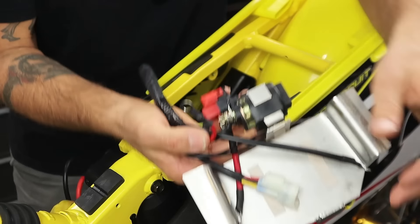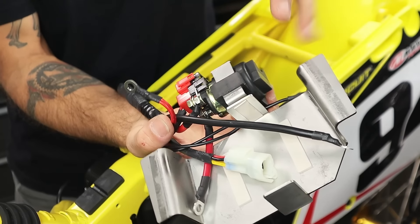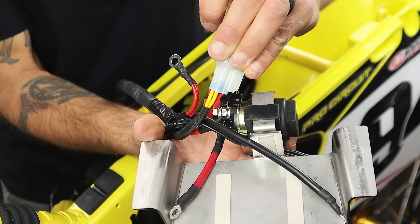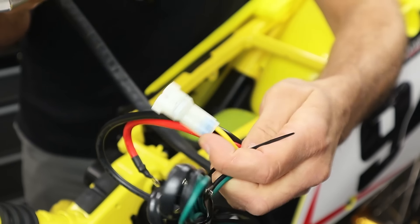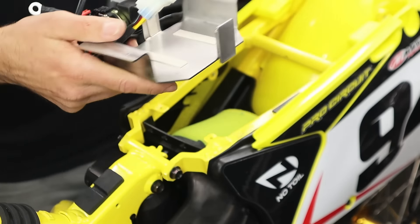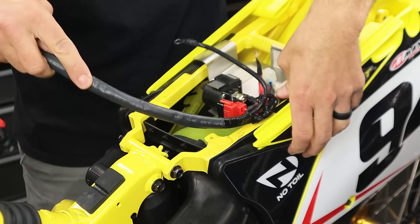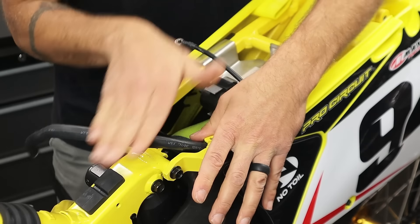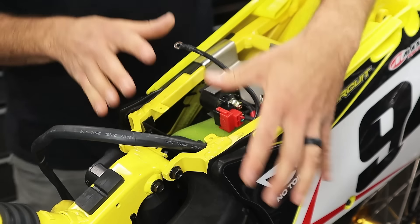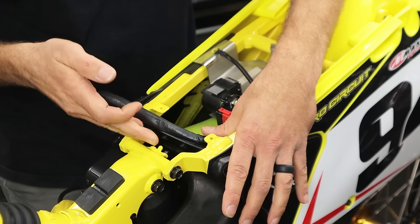On the non-charging system we have in our bike: you're going to get about 100 to 125 starts out of each battery between charges, so just keep it charged. This connector with the yellow leads is for the charging-type systems — I could delete those, but for now we're going to install it as received. This will drop in here, and on the RM I was looking for a good spot to have these wires exit — especially since this is a brand new OEM airbox, airbox boot, mud flap, all brand new. I didn't want to cut it, but I'm going to have to make a notch right here, and this is exactly where Panthera recommends you do it.